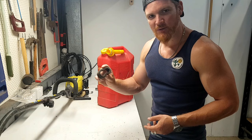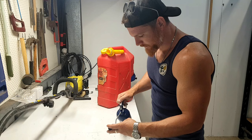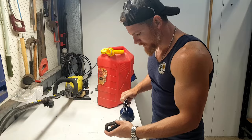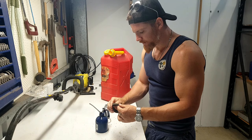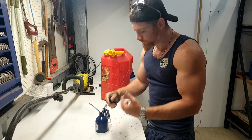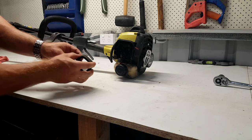Now that that's been sitting for a few minutes, you want to try and get some oil back on the filter. I've got this little oiler here — just a little bit of oil in it; I generally use this to oil up the Scott Bonnar. Squeeze it up. You don't want too much oil in it — you don't want to wring it out and have it dripping with oil, but you just want to work oil into it. If you do put too much in, just dunk it back in your fuel and you'll get it out. There we go — let's put that back in.